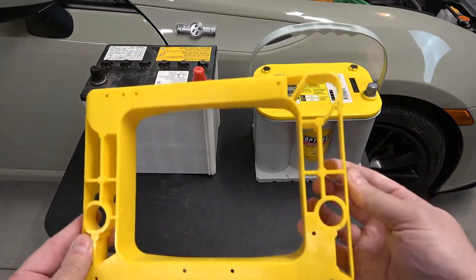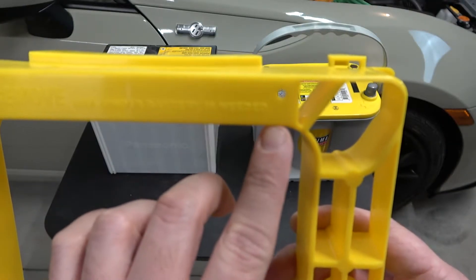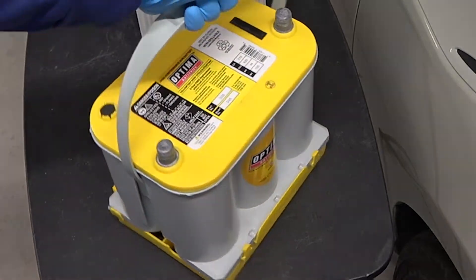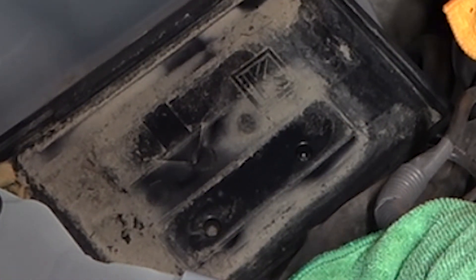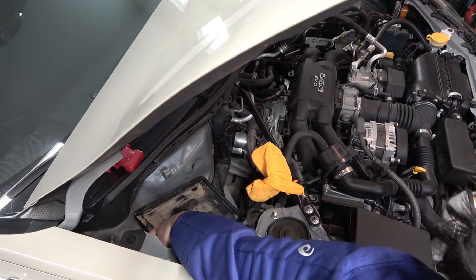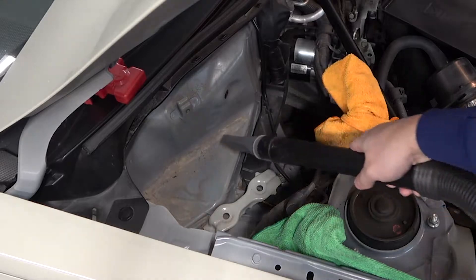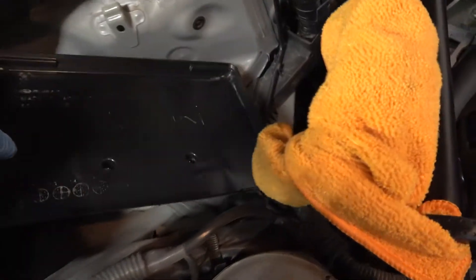When upgrading your battery in the same group size, you might find an alternate fit, as this is obviously an inch or two shorter. Luckily, Optima supplies a storage lid that doubles as a riser, and we don't want that extra bolt height sticking up, so let's snap the riser into place underneath the battery — the tabs all around the edge of the base will hold it together. Whenever you replace any part, it's a good idea to clean the area around it, removing debris, road dust, and dirt. There were even a few leaves down here. Luckily, Toyobaru has made it easy with this lovely battery tray, so let's give it a quick clean. It also helps to vacuum the surrounding area. Reinstalling the tray is a breeze — two indented knobs fit into the corresponding holes below, so alignment isn't an issue.